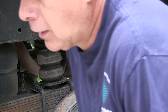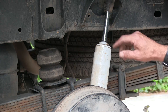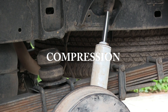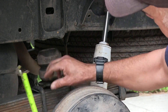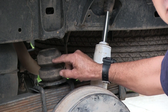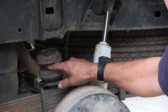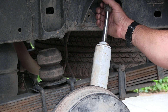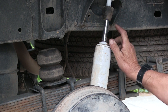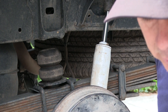I like the adjustable struts in the front, and the rest of the Ranchos, but oh well — not gonna hurt anything. Now I got less downward travel, but that doesn't make much difference because I got these big bump stops on it right here — Timbren. It's just a little over an inch before they make contact, and then they compress — they'll compress more than halfway, around three inches or a little more once they get past that. So because I got this rubber bump stop on the shock and these will compress more, that's as good as we're gonna get.